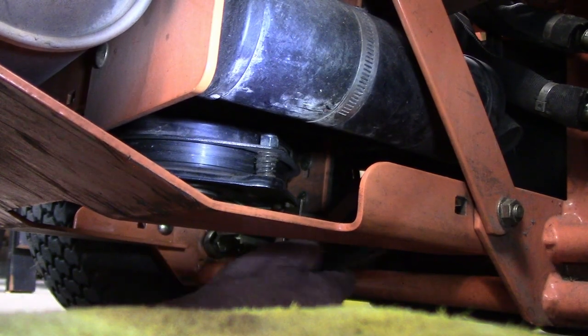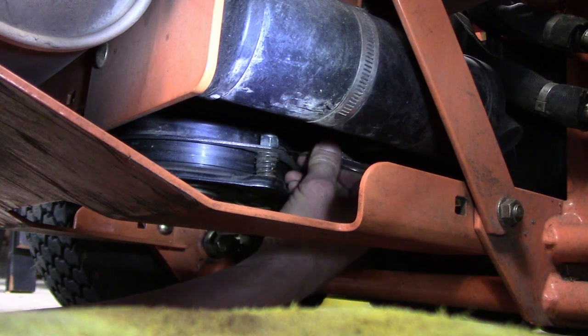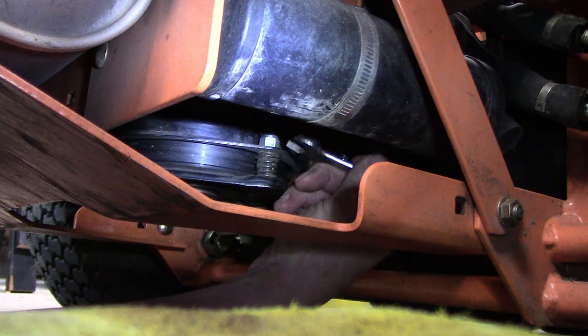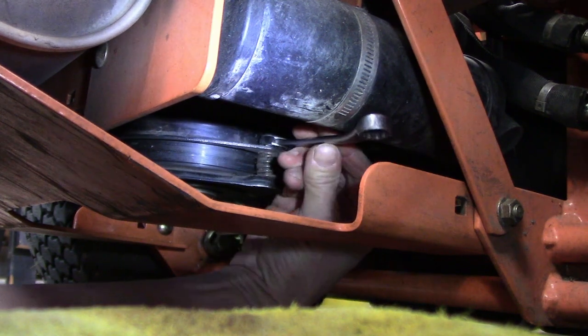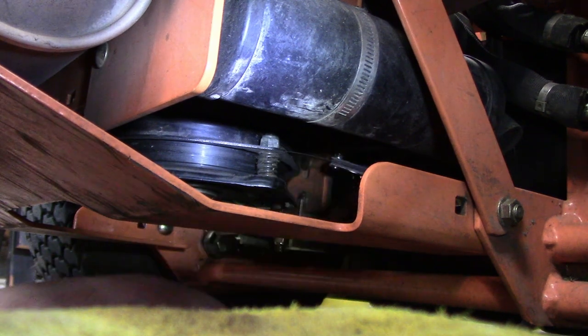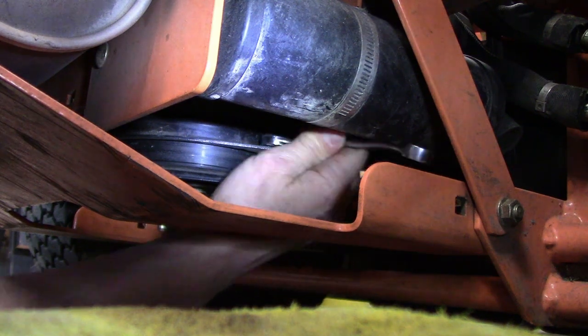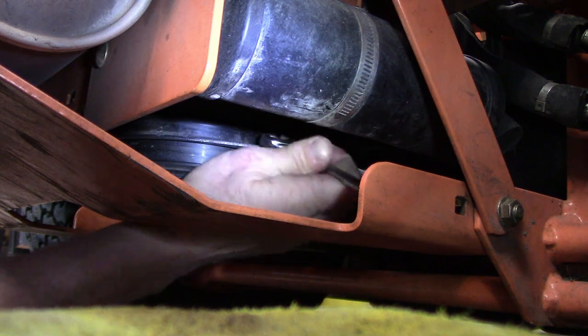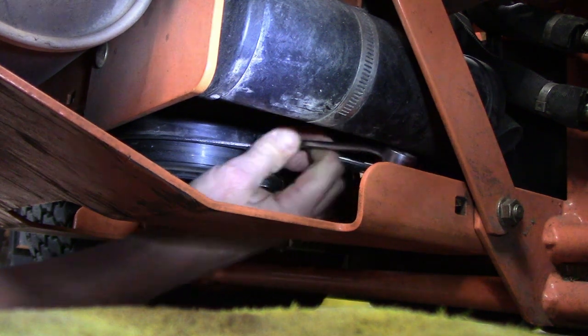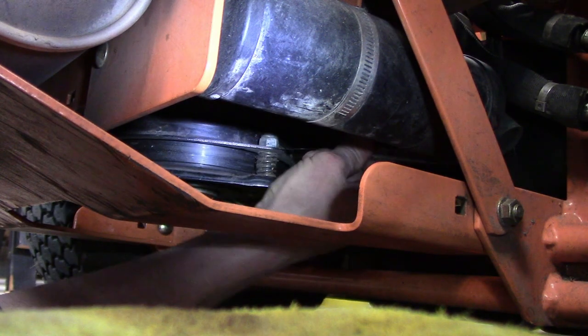This other side is going to be tougher because I can't really see anything — it seems like a long way to go. After working through it — a little too tight, a little too loose — I got it. I had to go around and check the clutch gap two more times, and by the third time adjusting it was all pretty much perfect all the way around.